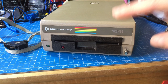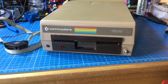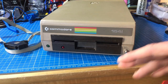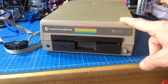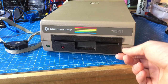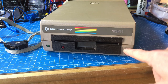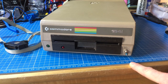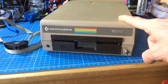This drive worked for me as a kid without DolphinDOS. I now have DolphinDOS in every Commodore 64 I've restored, in my ROM switcher. I can use DolphinDOS in this, which works just fine. The only problem is you can switch between ROMs - you have the DolphinDOS ROM and the normal Commodore ROM - but in the Commodore position it doesn't work for some reason. So I want to look into that and give this some restoration.